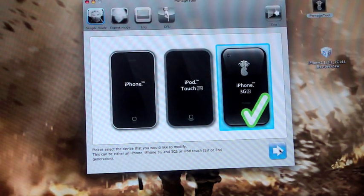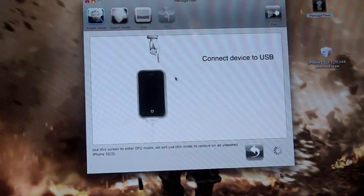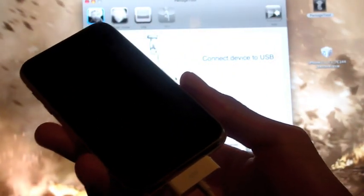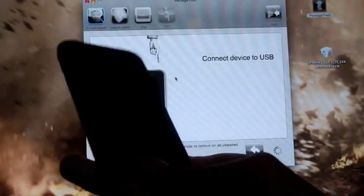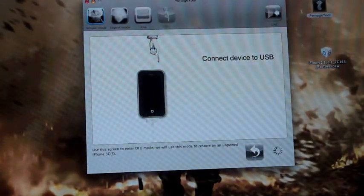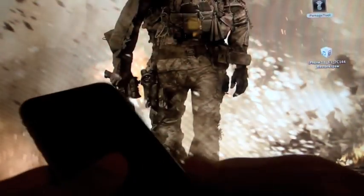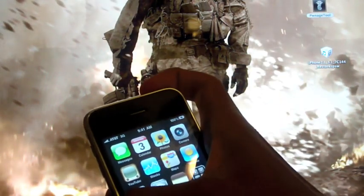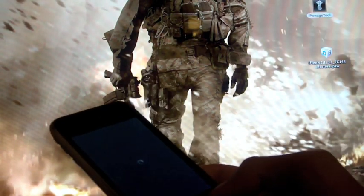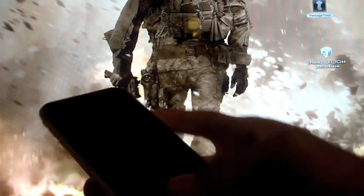When you're done building the .ipsw file, it should take you back to this area. The next thing you're going to want to do is go to DFU mode. You're going to have to connect your device via USB. This actually wasn't working for me — I don't know if it's because I have an iPhone 3GS. I've seen people with first generation iPhones where it was working. So if it doesn't work for you guys, I'll show you how to enter DFU mode manually. If it does work, it should show you instructions on how to go into DFU mode. Make sure your iPhone is turned off. If anything messes up during this, you can hold the home button and the power button for 10 to 15 seconds and it will completely reset everything.